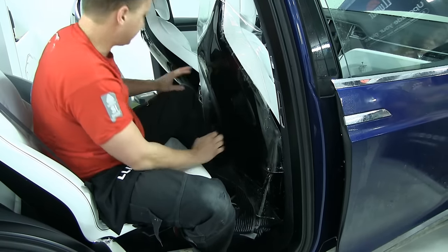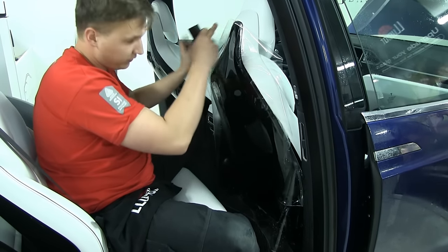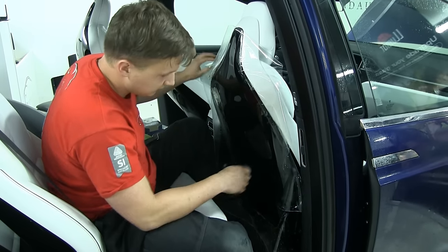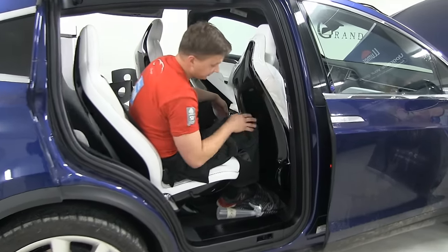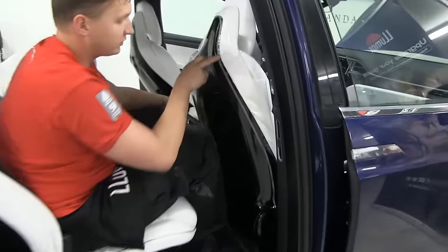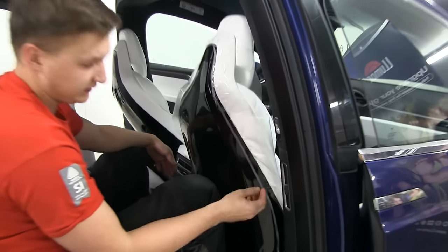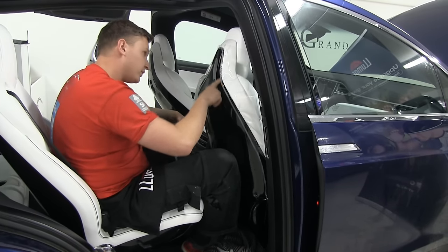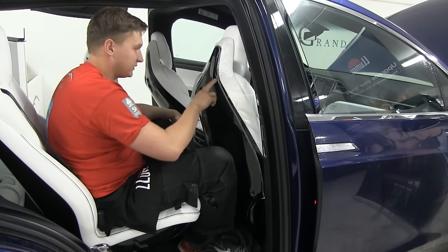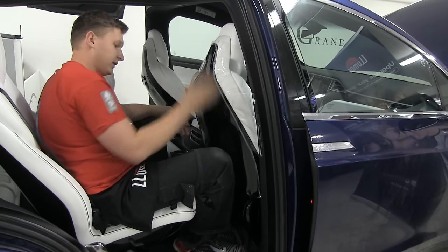So we're gonna finish off this other side because it's very hard to make a video from here, and then we're gonna come back when we're gonna cut around everything. So we finished the squeegeeing, and you can see we run on top of the knifeless tape like extra tape, which will give us the nice sharp clean cut. Unfortunately, we lost a little bit knifeless tape here, so when we finish cutting, we have to trim it a little bit because this knifeless tape is loose here, so this cut will not be nice. But everything else should be nice and smooth.